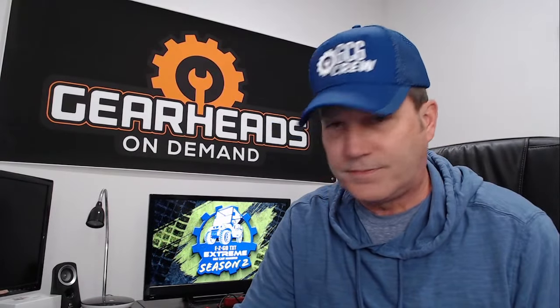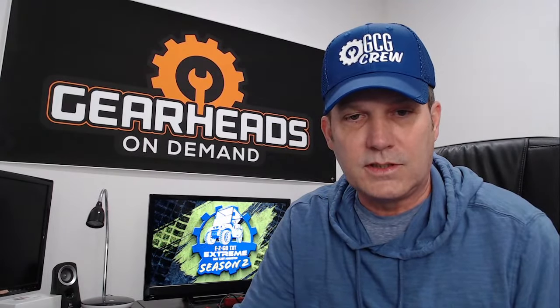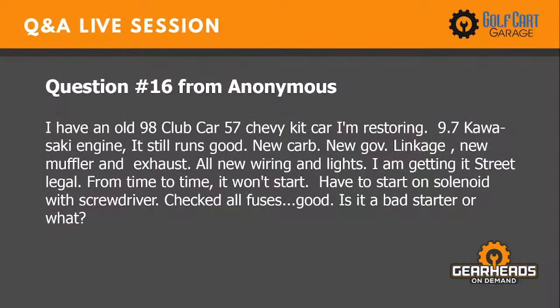So let's see. Question number 16. I have an old 98 Club Car, 57 Chevy car kit I'm restoring. It's got a 9.7 Kawasaki engine. It still runs good. New carb, new governor linkage, new muffler and exhaust. All new wiring and lights. I'm getting it street legal. From time to time, it won't start. I have to start it on the solenoid with a screwdriver. Checked all fuses, good. Is this a bad starter or what?